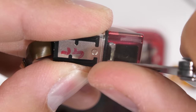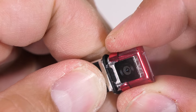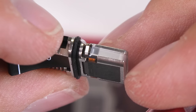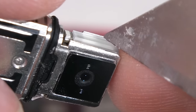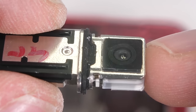So in order to find the LEDs, we have to remove the camera covering — the red plastic with the translucent bars along the side. My razor blade can slice through the housing and leverage off the top, revealing some pretty cool internals. The LEDs are actually located around the base of the camera and they shine up into the cloudy clear plastic. The light rays reflect off of the intentional cloudiness of that plastic, allowing the entire sides and top to glow. We've seen the same effect achieved in the ROG gaming phone.